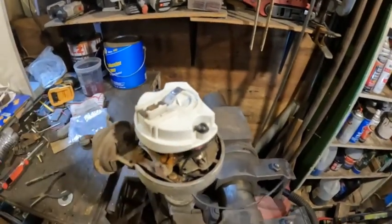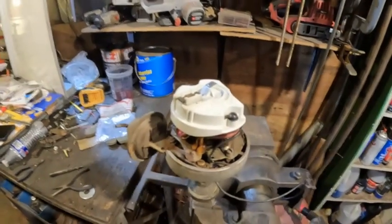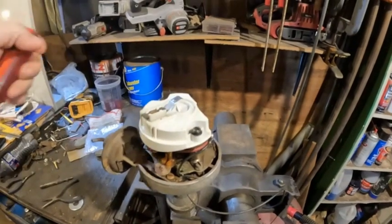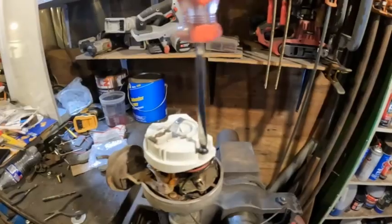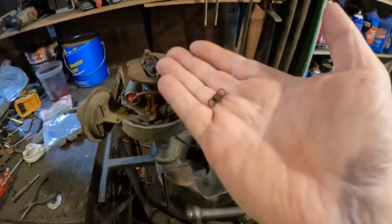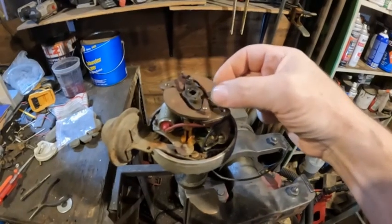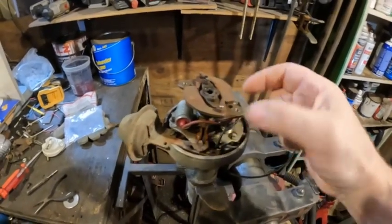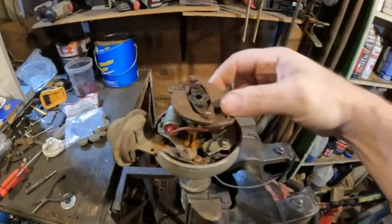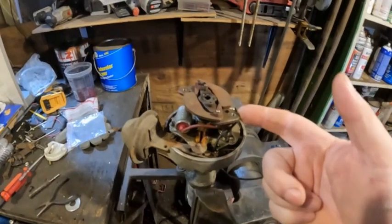As I've determined, it's really not necessary to hack the rotor. I was thinking it may be more accurate being able to pull directly on the balance weight, but it turns out you get exactly the same measurement just by doing this. So for those doing this at home, you don't need to cut your rotor for anything. I'm going to take the rotor off and show the weights and springs. Here's one spring that I removed — they're not very large, they just go from one pin to the other. They hold the thing from advancing until a certain RPM. With only one spring hooked up, this is going to be fully advanced at like 1,500 RPMs or something. I haven't run this distributor, so I don't know what RPM it reaches full advance — that's something that has to be road tested.